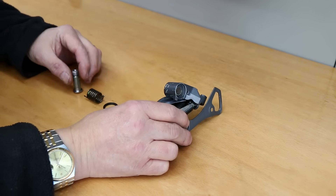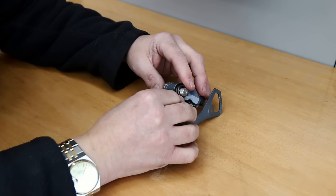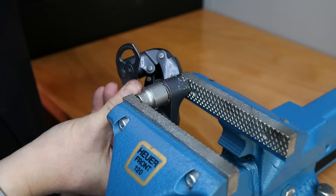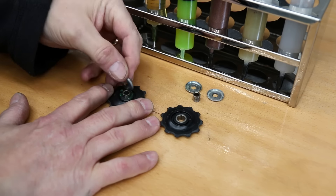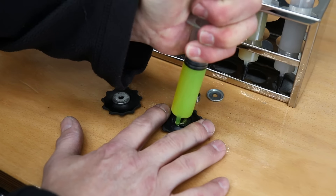You can see how much better that looks now — absolutely as it was originally. We've cleaned that up nicely, re-lubricating it, and then we pop it back together. There's a little retaining spring clip on there which we pop in — we use a small socket just to hold everything together and pop that spring in. That pivot will now work correctly.